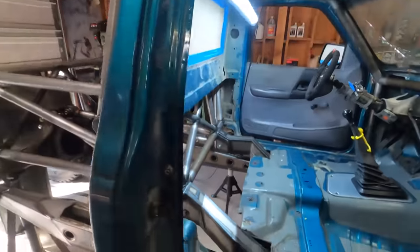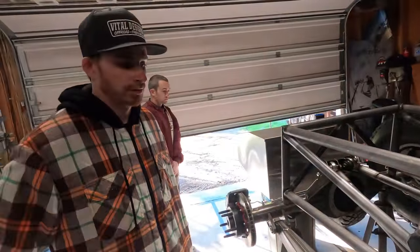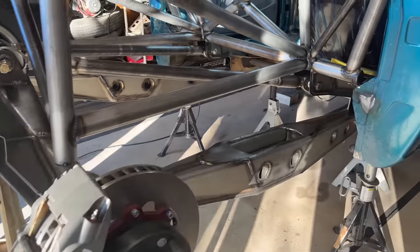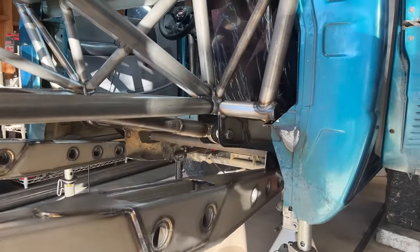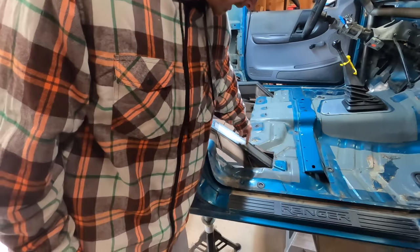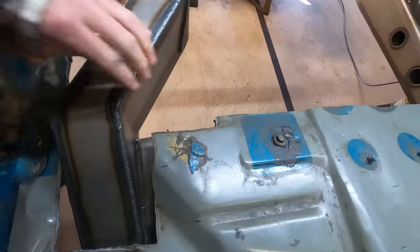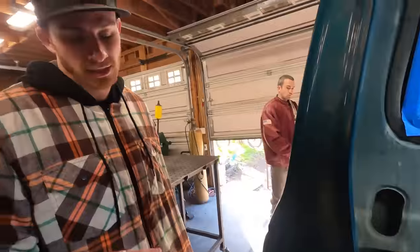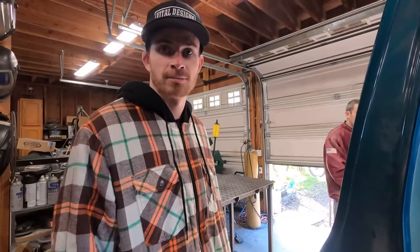When it comes to cutting the frame rail — that was done before the pivot boxes were on there. I basically swung the trailing arm up to the frame when the frame was still there and the axle was sitting there. I knew where the kick was in the pivot box to get it to come up over the frame. I took some measurements, knew where it needed to kick over on the pivot box, and we cut it right in the exact spot — first try pretty much.